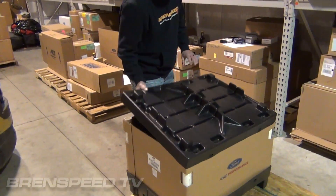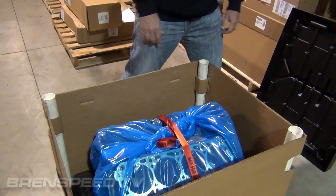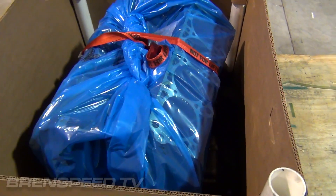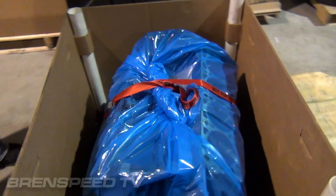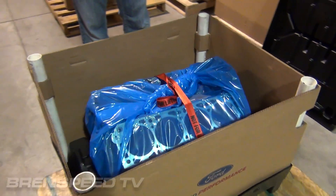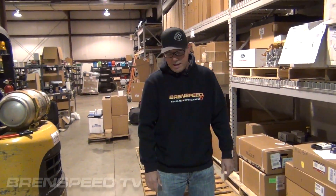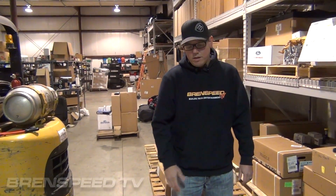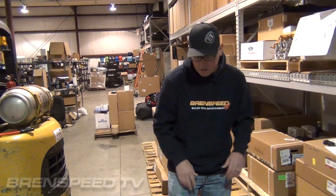So here we have it. Let's take a look inside. Here's how these come packaged up. It has a molded bottom — the block fits on it perfectly. They have a band around it and everything's sealed up really well. I was really excited when they released these blocks because we always used aluminum blocks on our 4.6 engines for a long time. These are a lot stronger. They have a larger bore, which allows us to get the displacement we need to make our 326 stroker.